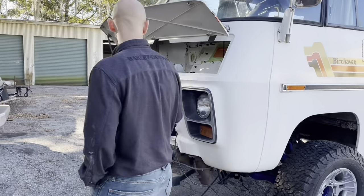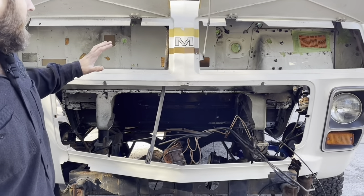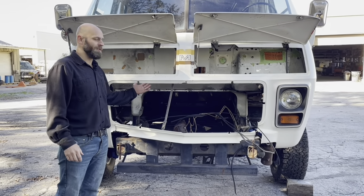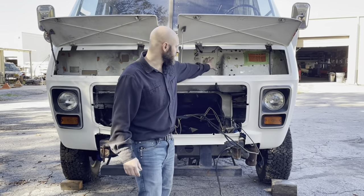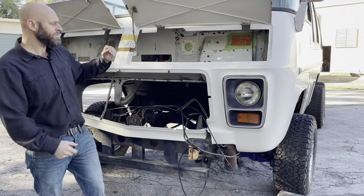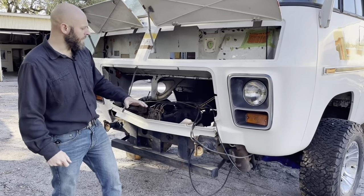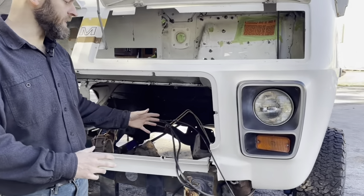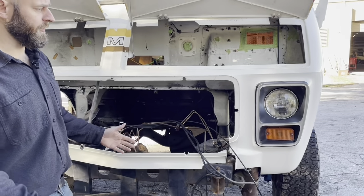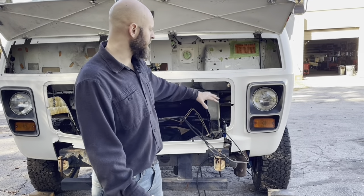Come up to the front — you can see it's already been gutted up here, we've taken almost everything out of it. This is going to stay pretty much empty up here; not very much on the outside here. We're going to have the brake booster in the typical spot and the windshield wiper motor. It'll obviously get a new steering column and a new steering shaft, and all the components are going to be either completely refurbished or brand new parts. The headlights are going to be LED headlights with nicely painted bezels.